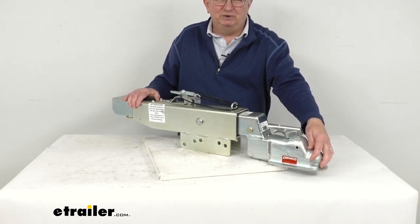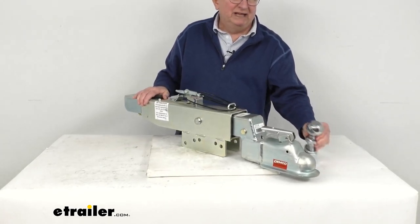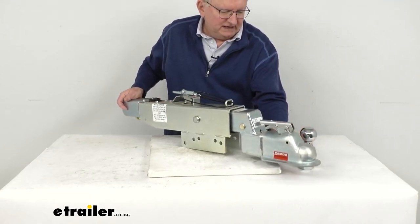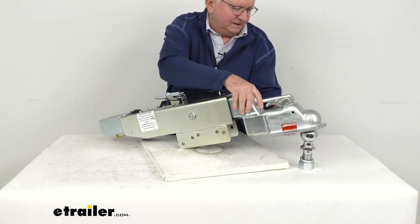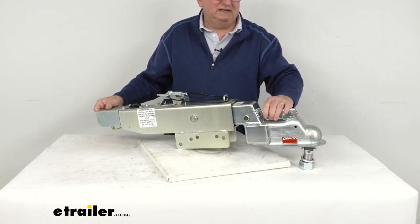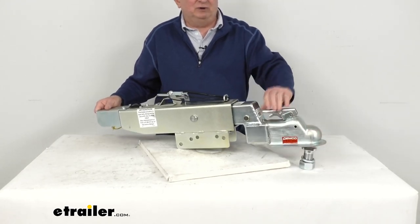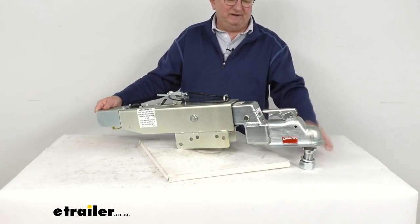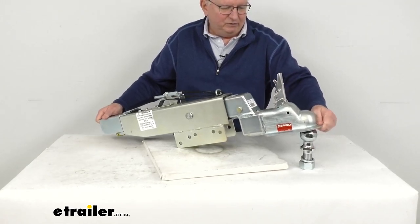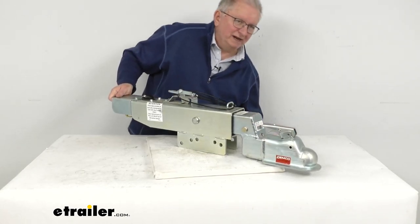As mentioned, this is designed to fit the 2-5/16th diameter hitch ball, and I wanted to demonstrate that easy latch mechanism. Here's a 2-5/16th hitch ball. If we drop this over the ball — just like that — and then push the weight down, you can see the latch raises up and locks into place. Now you're latched onto the ball and ready to go. You don't have to open your latch, latch it, and close it — you can just leave it as it is, drop it on, and you're ready to go. To remove it, just lift up on the latch and that will allow you to remove it from the ball just like that, then close your latch into place. It's a very quick and easy way to connect and disconnect.